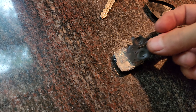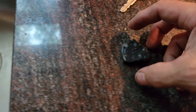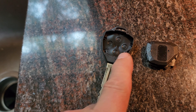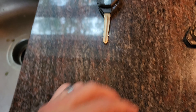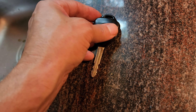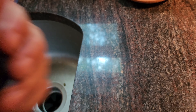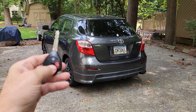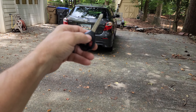Now the buttons for the fob are these little guys right here, which will go in this part of the key. So don't try to put it in the wrong way because then it won't do anything. Put your little rubber seal and just match it up with how it should fit. The buttons are facing towards the outside of the key. Notice the shape of this part here — see how it matches that shape right there? So that tells you it can only go in that way. Notice it fits in perfectly. Then just put the other side of the key back in place — push it together and it'll click in place when it's right.